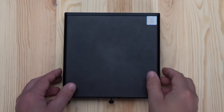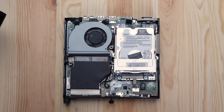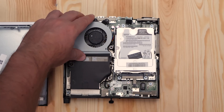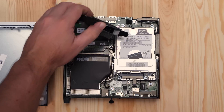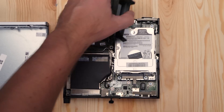Moving inside the system, it's not as easy to service as some of the other systems we tested. There's still just a single screw, and HP does a great job keeping it retained so you won't lose it. You just pop off the cover once you've undone that screw and you're inside. Inside, we have a pretty standard layout — up top is the CPU. HP puts the memory underneath the fan, so there's a little slide-out bit on the fan that you can pull out to get to the two SODIMM slots. This takes DDR4 memory, and the speed depends on the processor.